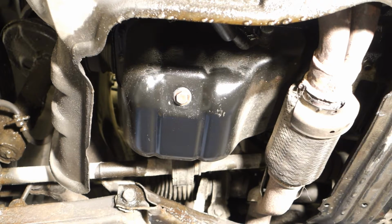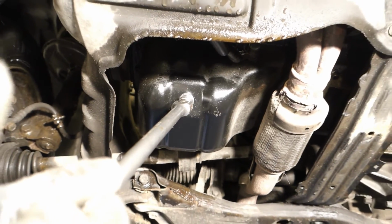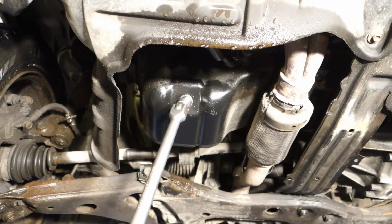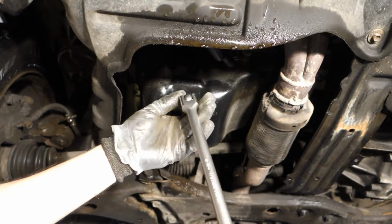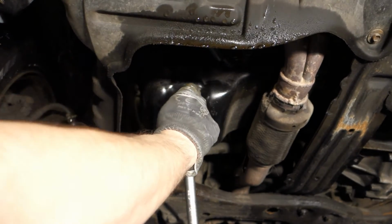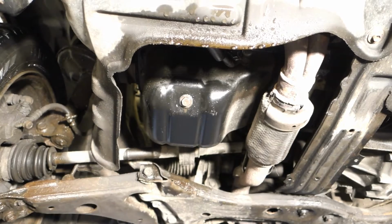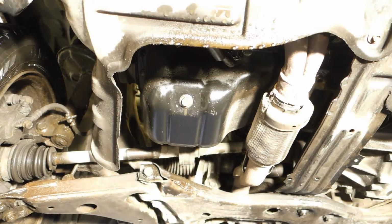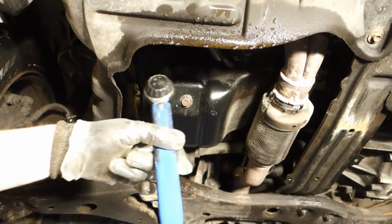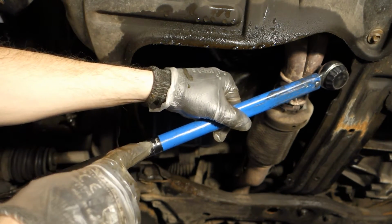Okay, and then we need to of course fasten that bolt. I take my tool, and first I fasten the bolt by hand only, rotating it, and then I fasten it a little bit more. And the final step is to do it with the torque tool. This Toyota tool is a specific tool that gives us the right tightening force to that bolt. And here I use a force of 60 Newton meters, it is scaled in here, or 45 pound-feet.